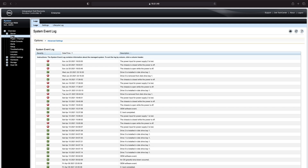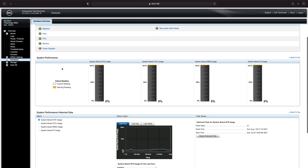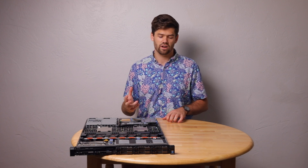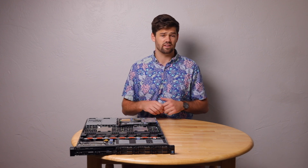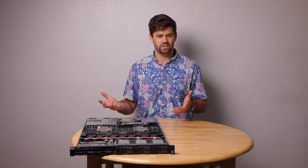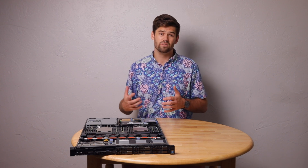Another thing that was really important to me was having an iDRAC Enterprise license. What iDRAC allows you to do, specifically with the Enterprise model, is access a web portal of the actual console. That means you don't have to go down and hook up a monitor to do any configuration — you can do it all remotely from your computer. You can type in commands, and you can even attach a virtual boot drive. If you need to install an operating system, you don't have to flash it to a flash drive; instead you can do it all from your computer and just upload it. So you can manage everything through iDRAC and never actually have to hook up a console to this thing. I don't even have a wired keyboard and mouse or a VGA cable at this point, because I just manage the entire thing online.